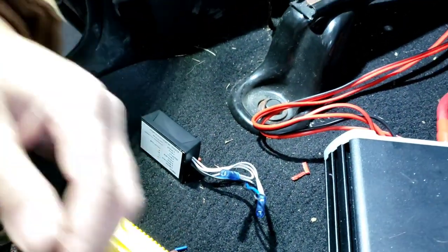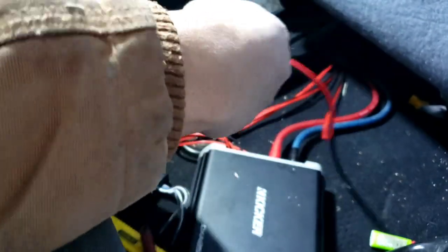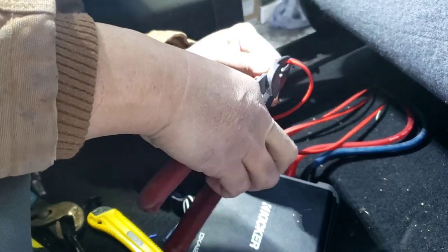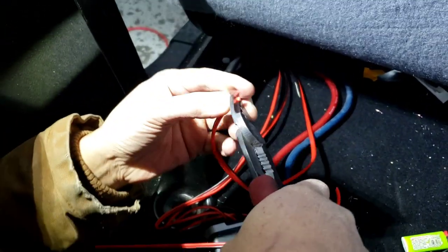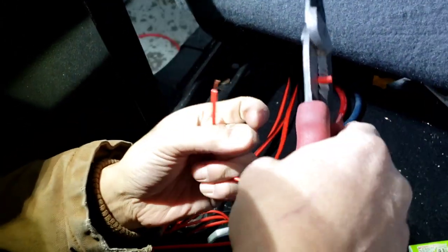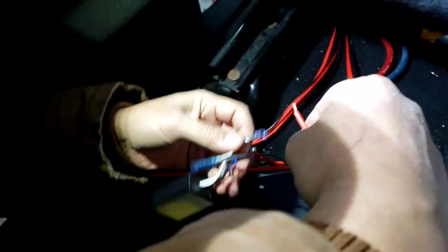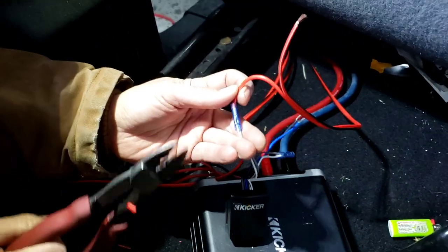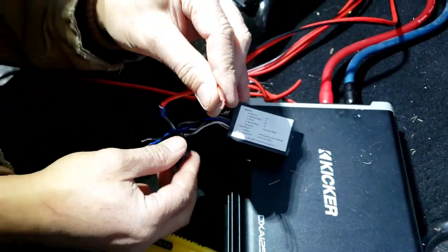I've been doing this for 20 years — well, this particular part probably about 15 years. So this is the speaker wire I ran from the front. I'm going to cut this part right here to make sure I have enough clearance, and pull the wire from that side so the wire is not all over the place. Cutting red — red is positive — so red goes to white/gray. The black part goes to white/black, gray/black.